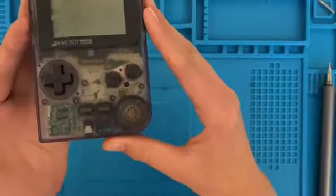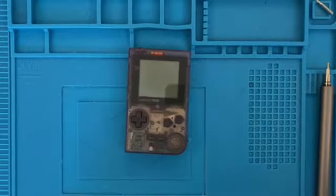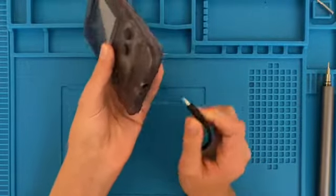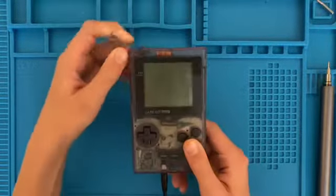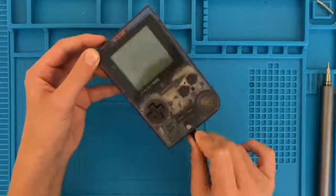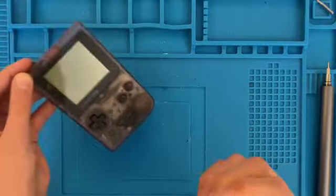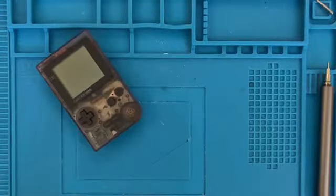The start and select buttons are also discoloured — they've gone a green colour. I have a DC connector here. I have tried this with batteries and got nothing. I haven't tried it with a DC connector yet, but I'm not hopeful. And nothing. When I spin the DC barrel, it's very crunchy, and that has made the end of the DC connector go green, which is not good.